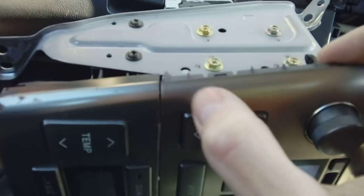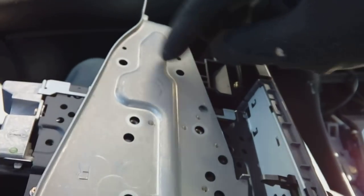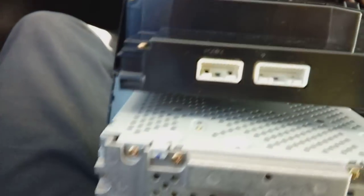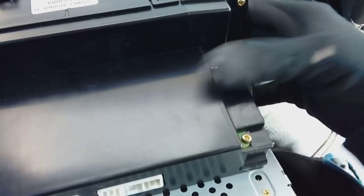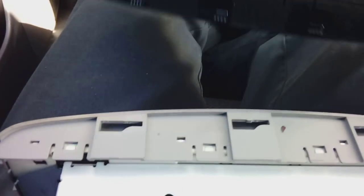You'll notice there's a plastic clip system along here that you have to slide out and disconnect to remove it. Once you've taken your screws out from the side plate, remove the two from the heater part as well — one here and one here — and four for the radio. Then look at the heater piece: it's got some little clamps underneath. What you do is slide it across — so with the radio facing me with its back towards me, I shove it towards the passenger side of the car, then out — because it's on little locating dowels. Move that safely out of the way.